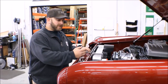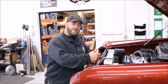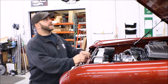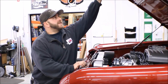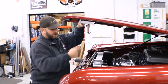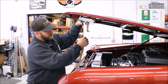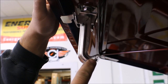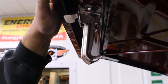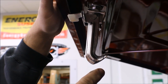In addition to filing down the safety latch plate to make clearance for the condenser, you'll also have to make a modification on the safety latch itself. The safety latch will come down and actually touch the front of the condenser, so by trimming off the tip of the safety latch it'll allow you to clear the condenser without poking or rubbing into the condenser face.